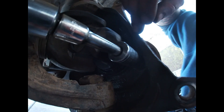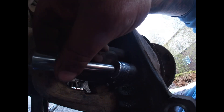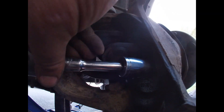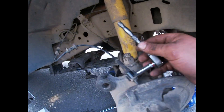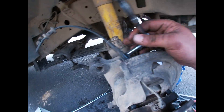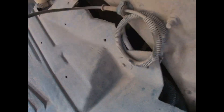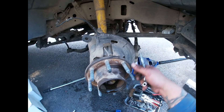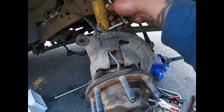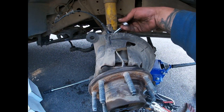To get those four rear bolts in the back, that's going to be a 13/16 also, to take off the hub itself — the hub assembly. This top one right here is going to be an 8 millimeter, and then you're going to have the connector — just remove that and install the new one. At that point this is pretty much out; just got to remove all these little things right here.